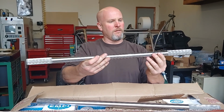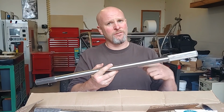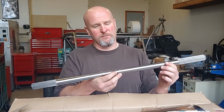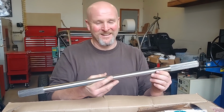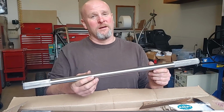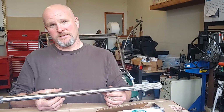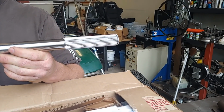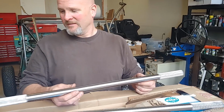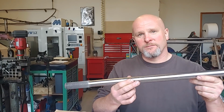And the dangerous thing about this is the engine runs, and now we have axles to make it move, but it doesn't have brakes. So it can steer and go, but it can't stop. And I'm gonna be a good boy and tear this thing all apart and weld the frame all up before I put these in and test it. Otherwise you'd have a pretty bad situation driving it with just tack welds. All right, well let me pull off one of the back fenders and you can see where these things go.